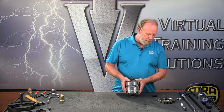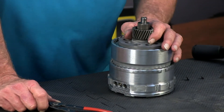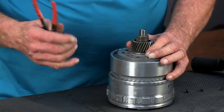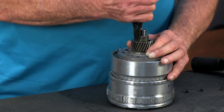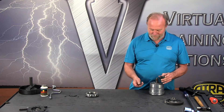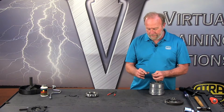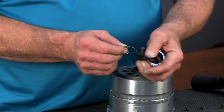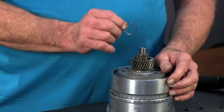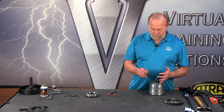The first thing we're going to do — there's a snap ring down in here that can be problematic. It's definitely necessary but I practiced this a couple of times. That's how that's supposed to work. You can do it with just a pair of small snap ring pliers, and the tabs face down. Let's put this back together again — the tabs face this way. Very critical. If you put it in the wrong way, it might not load up into the case correctly when you're doing your final assembly.